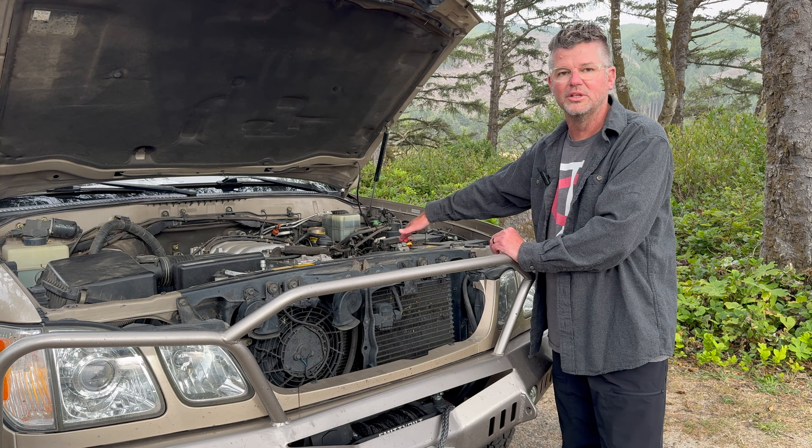A lot of little electrical things just make the car work better, and they apply to pretty much any overland vehicle or any vehicle you're trying to make more off-road ready. This vehicle came with daytime running lights, which I don't care for — there's a bypass you can find easily on the internet. What I did do under here is: Toyota turns all the 12-volt lighters off when the key is off, so by removing this relay and putting a jumper in, it keeps the 12-volt lighters on all the time. If you have a fridge in the back, that's really handy because it's not shutting off. Just be aware that if you leave something plugged in and you're away from your car for a couple of days, it could drain your battery. I carry that original relay with us in case I ever want to put it back in.